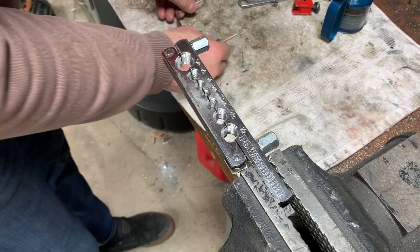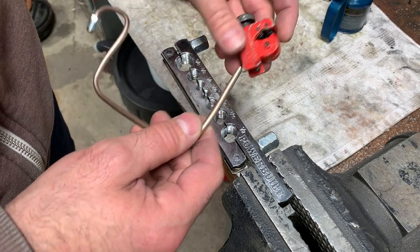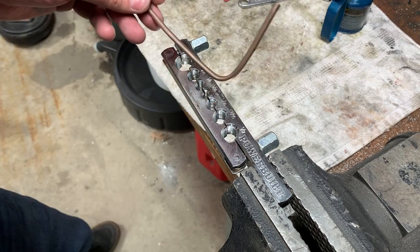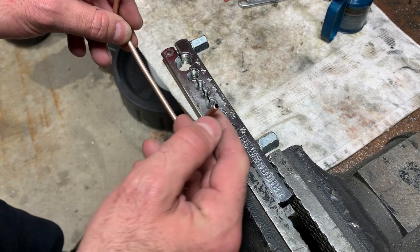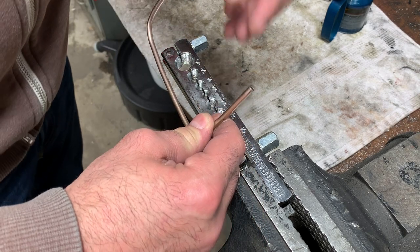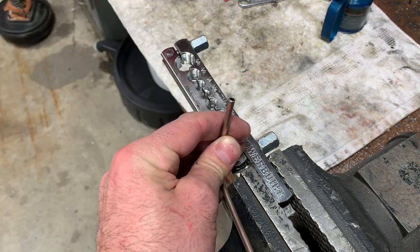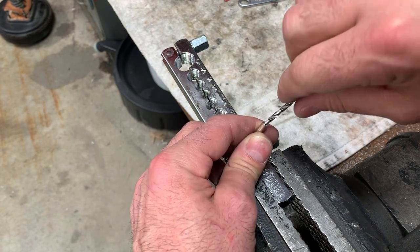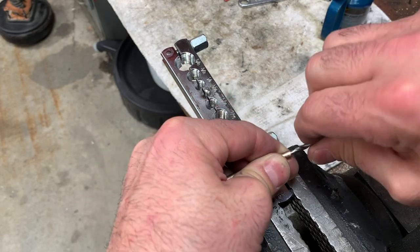Okay, first things first, obviously you saw me cut my pipe, try to get a new one. This one's super old, but it does the trick. Now, you're not going to get a super clean cut with this. And as you can tell, let me see if I can get the camera to zoom in here. You can kind of see that when it cut through, it left a little edge on the inside. So I usually take, instead of deburring it in there, because you can thin the walls out at the top, which is not what you want to do, a little drill bit and just work it in there. And eventually it'll go all the way in. It's kind of hard to do with the camera in front of me, but.